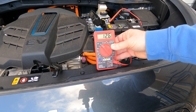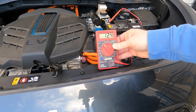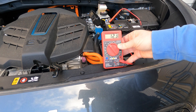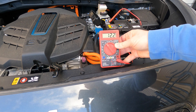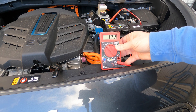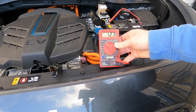That lower level is really what you want to check, because that's what's going to determine when the car's been sitting — the telematics have been running, some other small draws from the car are going to run this down a little bit while it's not being charged. And this is the voltage that needs to fire up the computer after the car's been sitting on a cold, snowy morning at the airport for two weeks. And if that's too low, you're going to be stranded.